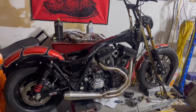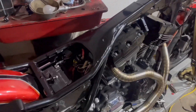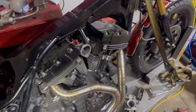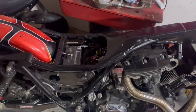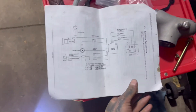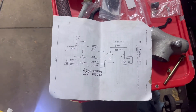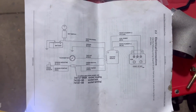I just finished up wiring my twin cam swapped FXR. I'll go over a little bit of the wiring because I personally couldn't find a ton of info on it and just had to go as I went. I ended up going with a Thunderheart ignition setup and an M unit. The wiring diagram for the Thunderheart is super simple — you can pause and screenshot it. It comes with the Thunderheart when you buy it, and most aftermarket ignitions are gonna be similar to this.